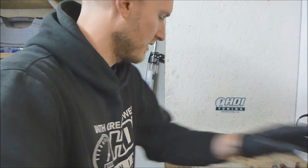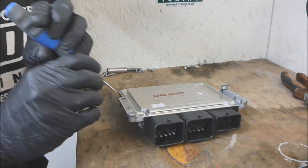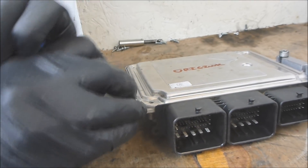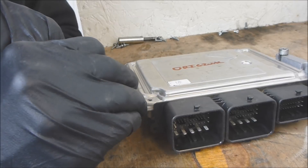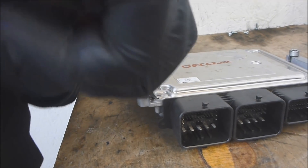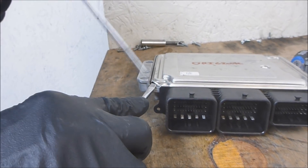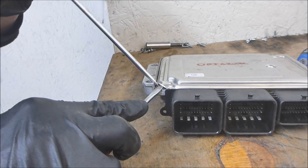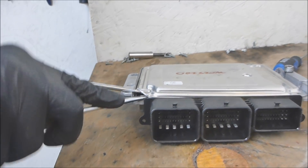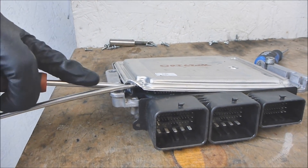It's nice and hot. Eye protection is recommended — it's quite common for screwdriver tips to break off when you're doing this. So the starting point on this one is just here; it's actually very tight. What we're going to do is bend it up just enough so that we can get a bigger screwdriver in there. We don't want to break the tip off the small screwdriver. Be very careful that you don't push your screwdrivers in too far because you could knock a chip off the board.